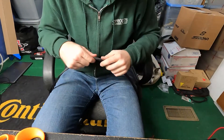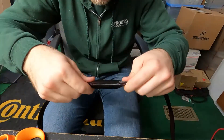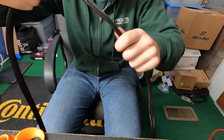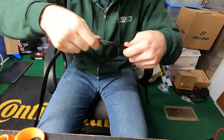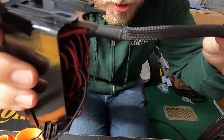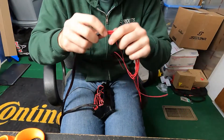Now I need to try to get them through some wire loom. First I'm going to throw some heat shrink over the end here — that's just to hold the end of the wire loom once I get it on. This wire loom can be a little bit tricky to get the wires through if you don't know a little trick. This stuff's expandable, so if you push it together it gets big and you can see the wires on the inside. So you expand it where the end of the wires are, pinch it at the end, then pull it down and that forces the loom up the wire. Repeat that — squeeze it by the end, grab the end of the wire, and push the expansion down — and just keep doing that until it gets to the top. Then I did the heat shrink on the end of the wire loom to keep it up there.